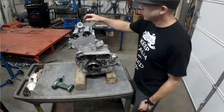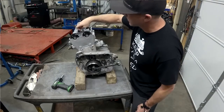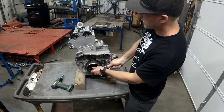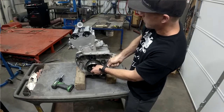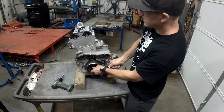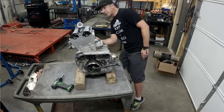So we look at this little indicator we set up on the cam cover — it's pushing right on the tappet. So when we go up and down we can see that it moves both directions, and then we go to the highest point. That's the top of the lobe, so that's the centerline of the cam, and we look at what degree it is.